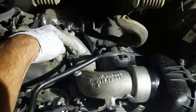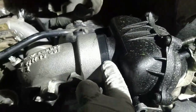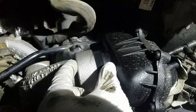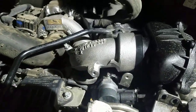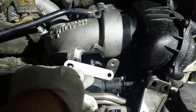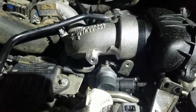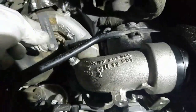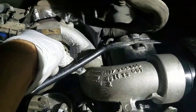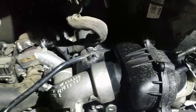There's this piece which rotates here and then comes up to here, and this seal — this was all spread apart. What happened was they had a bracket here that's elongated and it was loose, so it opened up. Then the other bracket, which is the same part number back here, broke — so it allowed it to come apart here and rotate back on here. And all it was, I believe, is this leak.